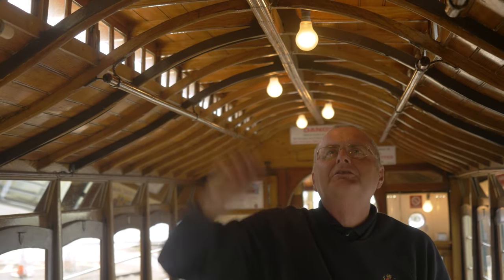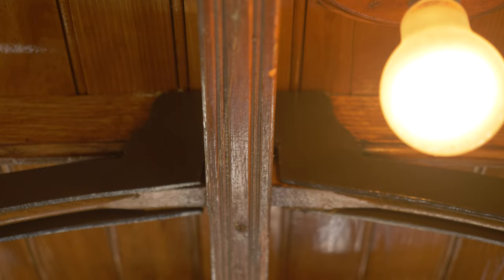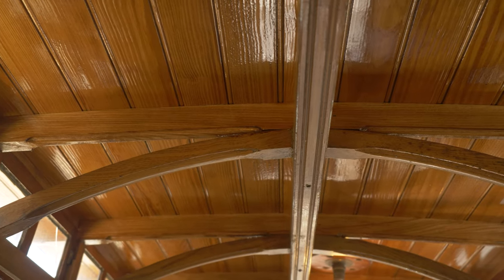The flat piece on top is where, traditionally on a double-decker horse tram, you'd have the knife-board seat on the outside. Another clue to horse tram design and evolution is that the bodywork is very strong but simple in cross section — the timber is quite small — because in a horse tram, the lighter the tram, the greater the load the horse could pull. You can really see the evolution from horse tram to electric tram in this vehicle.